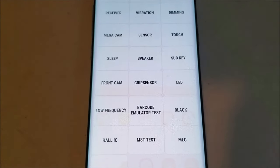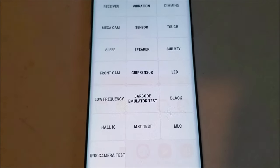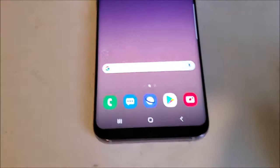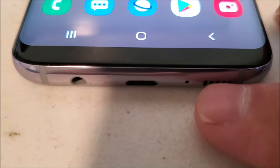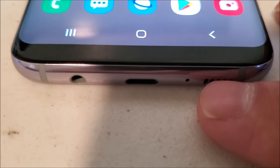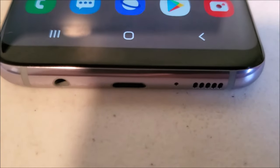So then you have to look at other fixes. One of the more common fixes, if you read through the forums or Reddit, is the microphone pathway, which is right down here. On almost all Android phones, right at the bottom, you see this little hole. This is the pathway to the microphone. If it gets clogged with dirt or any kind of debris, then it's going to block or muffle the sound.